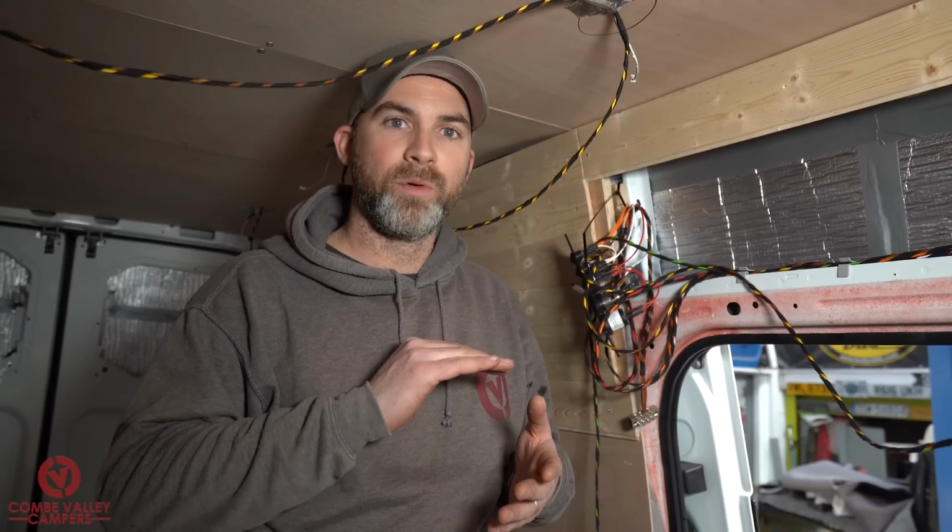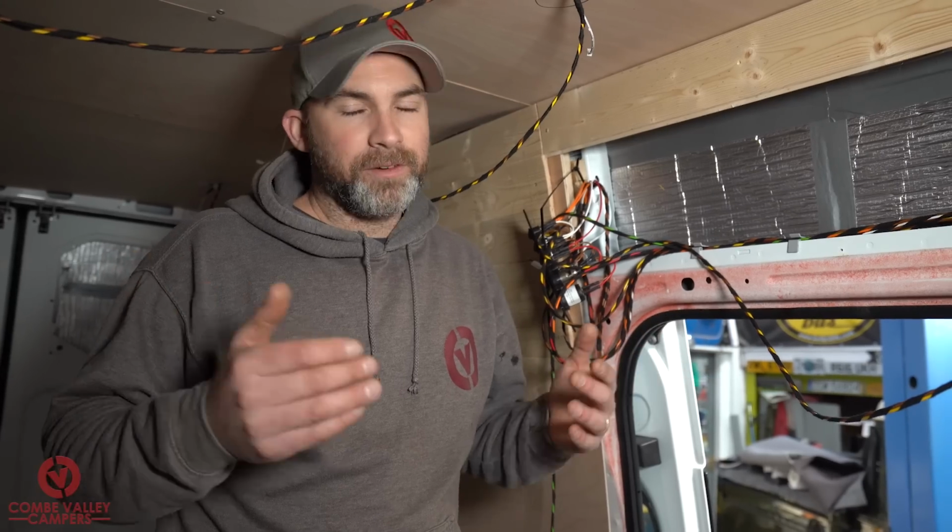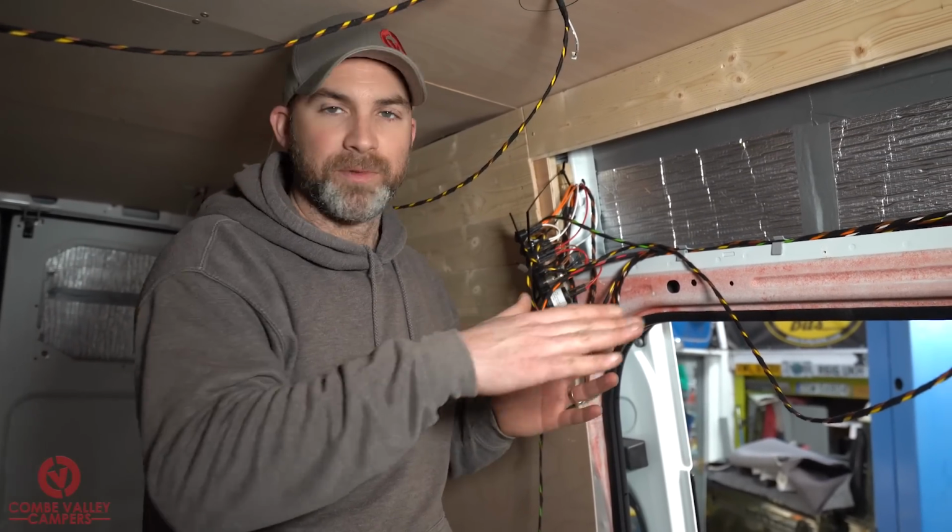What you've got to remember is that sharp edges are going to affect your cable long term. If you're passing wiring through any sort of metalwork, please be sure to run it through a gland or a rubber grommet as it passes through bodywork. If your live cable rubs against any metalwork, you've got the potential to short that circuit out, and then you're in a whole world of pain, potentially. You know, there's all sorts of things that could happen when cables short out, and what we're trying to do is just show you how to route that safely.